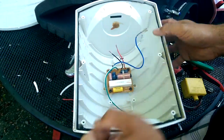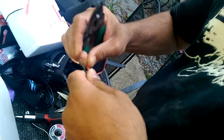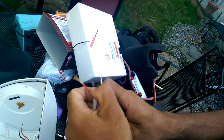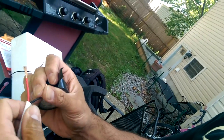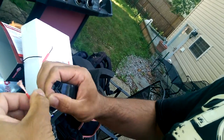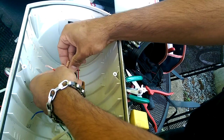Just need that speaker wire. Using a short jumper. Does it matter the gauge of the wire? Not really, as long as it's at least 16 gauge. I usually like to use at least 16. If it's a long run, maybe then you go up to a 14 gauge wire. But 16 is enough for just a little repair. So I'm going to put these two together,